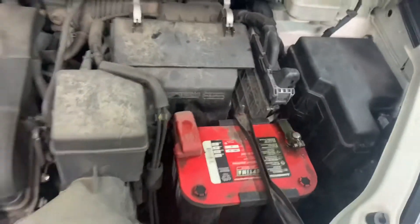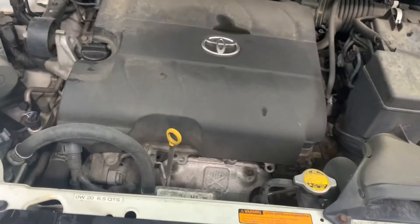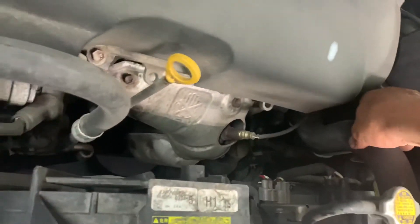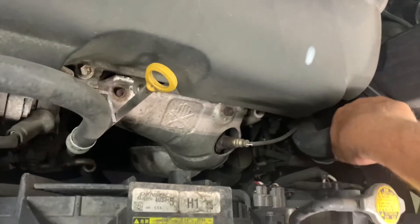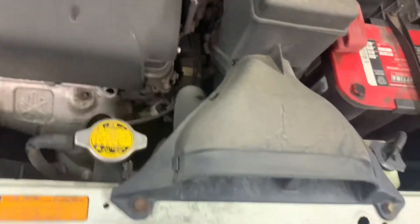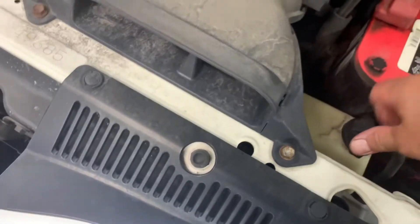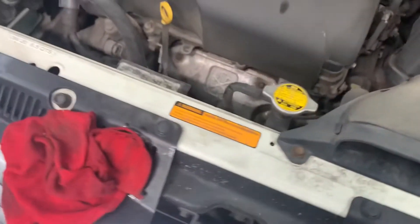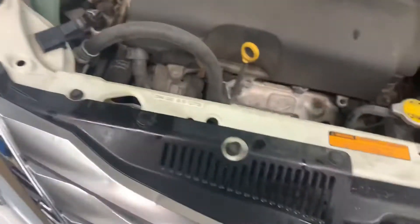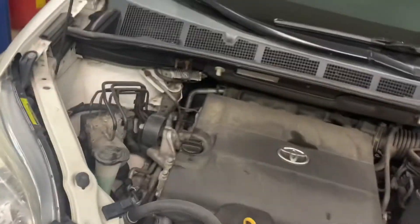Check your antifreeze. Grab your upper hose, pinch it — if it's still warm and not pushing fluid back and forth, it's still under pressure. Check the overflow — look inside and see if you've got fluid in there. If you can squeeze the hose and there's nothing there, it looks like you've got a leak. That's the pre-inspection.